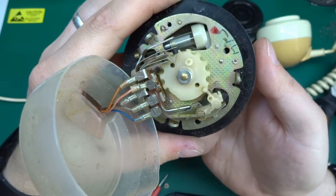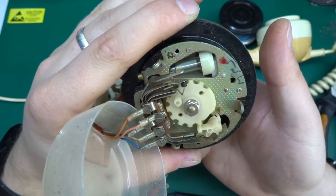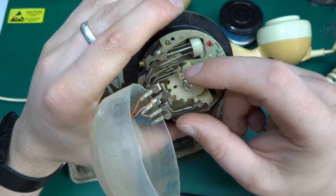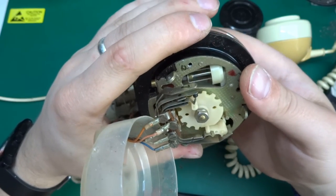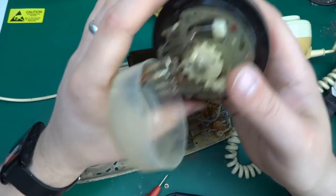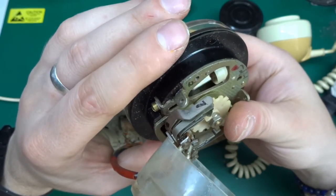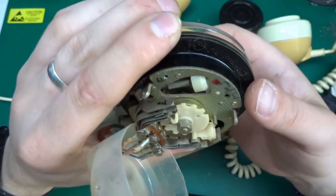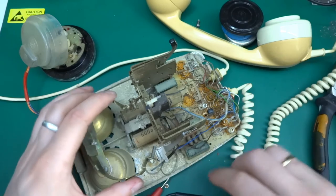That was two - so if I do zero, this will do the whole 10. Let me slow it down so you can see - that's the full turn for zero. And when it's finished dialing, this little arm here presses against this, which effectively breaks two contacts over here. I think that means you can talk because it's effectively using the same line to send voice and dial the pulses.